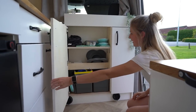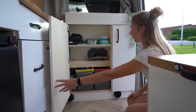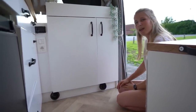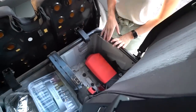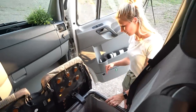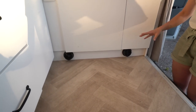On the other side we have our two trash bins for recycling, and some other kitchen storage like foldable boxes and a shelf for Pablo's things. Underneath the cabinet are two black outlets for our diesel heater. The diesel heater itself is in the front passenger seat area. Inside the front seats we also have a first aid kit and insulation panels for the front window so we can close everything off. It's a Chinese heater — the air intake is at the bottom of the van with the dirty air, and the warm air outlets are here in front. It gets really warm pretty fast and we really like this heater.